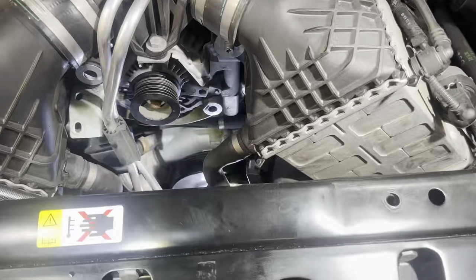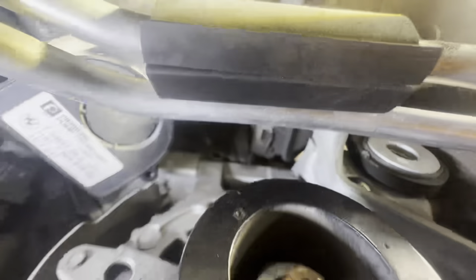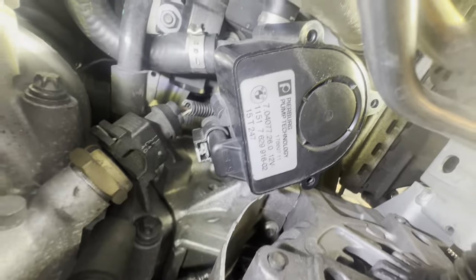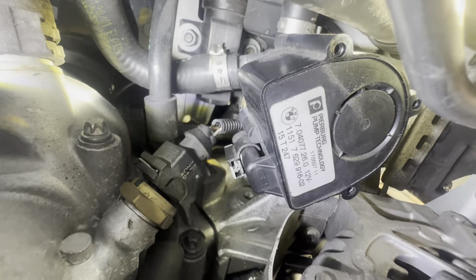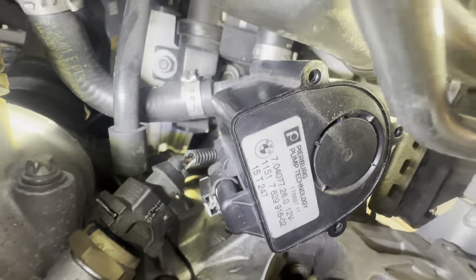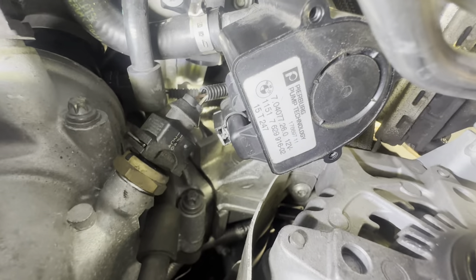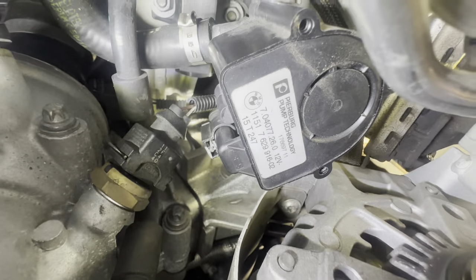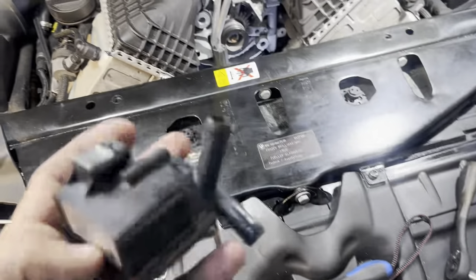At this point the bracket is removed from the pump itself, as you can see in there. There's the connector — we're going to remove that connector next, and then this hose, the one that's closest to us, and the one on the front will be next, so that we can maneuver it out without removing pretty much anything else. The old pump is out — first you undo the connector, then the lower hose, and then the side hose.